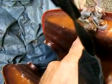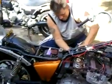you've got a little vacuum line. Now if you look over here on the bottom of your petcock, right there you'll see that same vacuum line, and that's a little diaphragm in there. And without that airbox, there ain't enough pressure to pull that off. I know a lot of guys that get rid of these vacuum petcocks, but on a bike like this you don't want to do that.